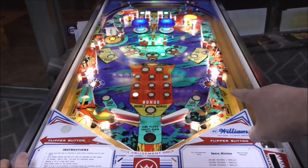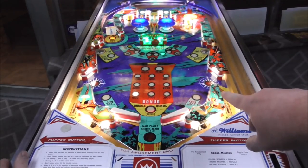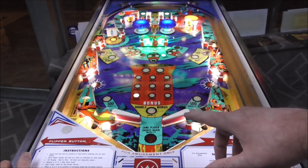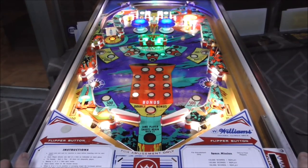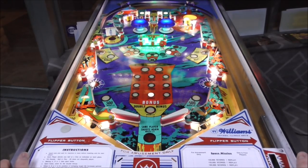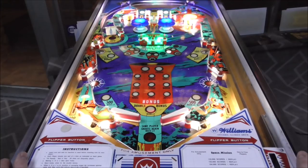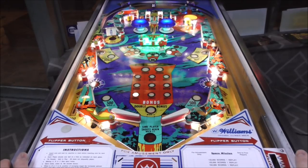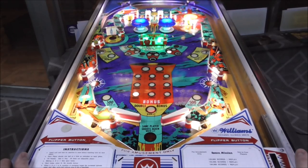I looked into it earlier whenever it didn't score over here too. Sometimes it can go down and just not hit the metal, the little switch. That's part of it. And also on one of them, the special was lit, which is you win an extra ball, and I already had an extra ball activated. So see the top where they say score swinging target value when lit, that one right there. So that just scored 5,000 points when I went through that. And it did not lock on, so I think we may have fixed it. It was some kind of just physical, mechanical problem.